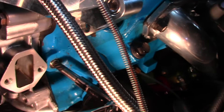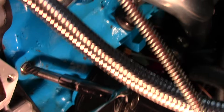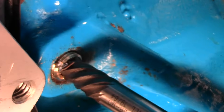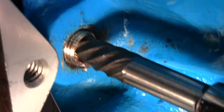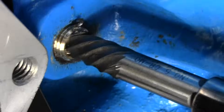What I have here is my socket wrench attached to the extractor, because I can't get a drill in here. I didn't really want to go start spinning a drill this close to the engine. I'm just turning left-hand with nice, clean force on the ratchet. This is not something you want to rush — I'm basically just threading this baby out.